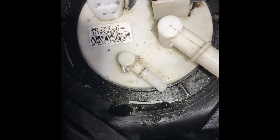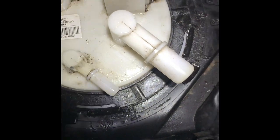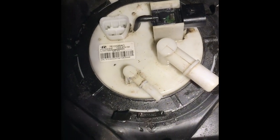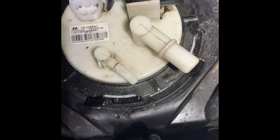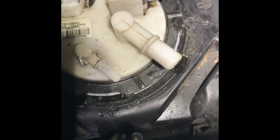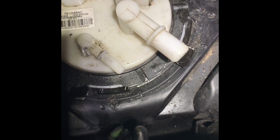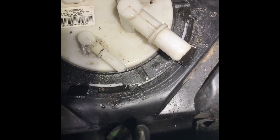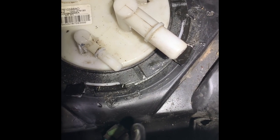All right, this is the 2013 Hyundai Sonata — I got the fuel pump assembly back in. I bent all the holding ring tabs up, as you can see. I got the gasket on first — I put it around before putting down the ring and the pump. Put down the green o-ring first, then the pump, and then the lock ring on top of that.